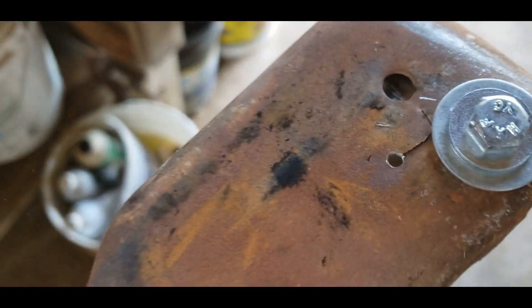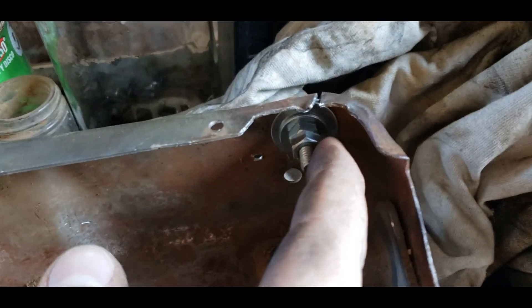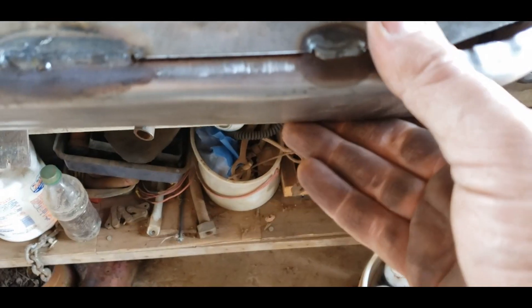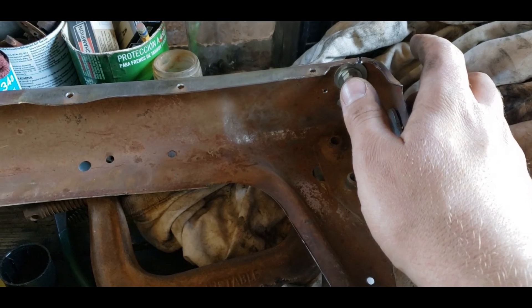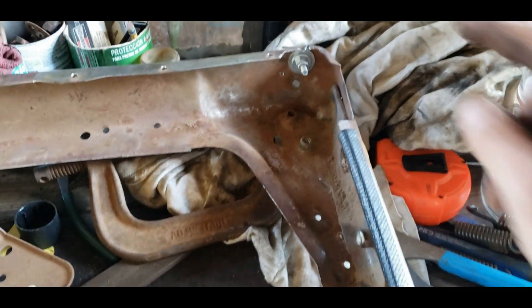I drilled a little hole here where that split kind of ends, and in theory that will stop it from getting worse. That other split will go towards this big hole and stop eventually. I've got a bolt in there — just a quarter by one, probably quarter by one-and-a-quarter or one-and-a-half — and double-nutted. A lot of people are probably going to say, why don't you just weld it? The reason is this is sheet metal, it's stamped. Even at the factory, there's not a lot of penetration there. While I would rather have it welded, in this case the bolt is going to serve just fine because all this thing has to do is run another 24 years and 200,000 miles.